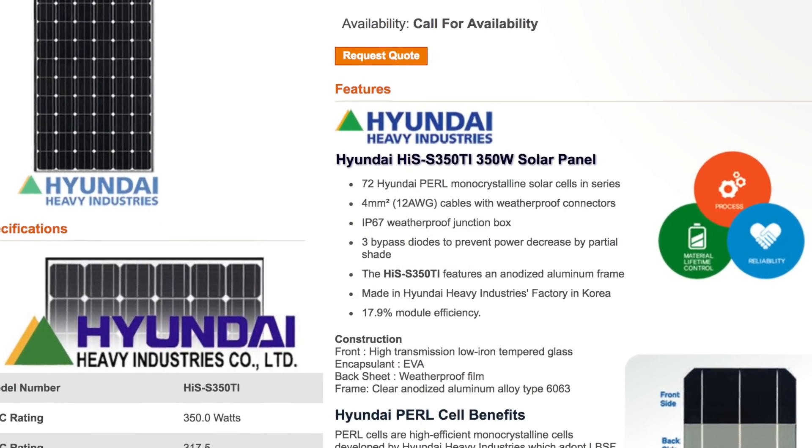That's about 30 items that'll make up my solar setup. The items I don't have yet that I'll be purchasing in San Diego are the solar panels — I'm going with Hyundai solar panels, 350 watts each, two panels for a total of 700 watts on the roof. I still need large battery cables and the batteries themselves. I've decided to go with liquid golf cart batteries, mounting them underneath the frame in a separate box. I've been told this setup gives longer longevity, better price point, and better utilitarian use. I'll probably go with Crown or Trojan batteries, depending on what I find down there.